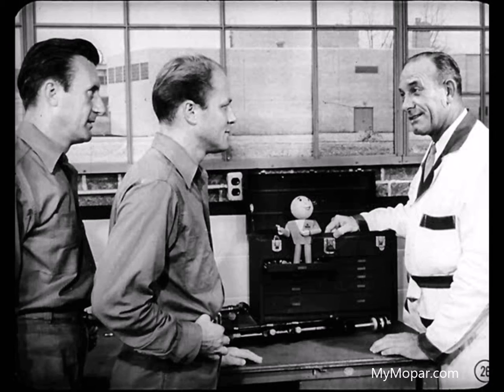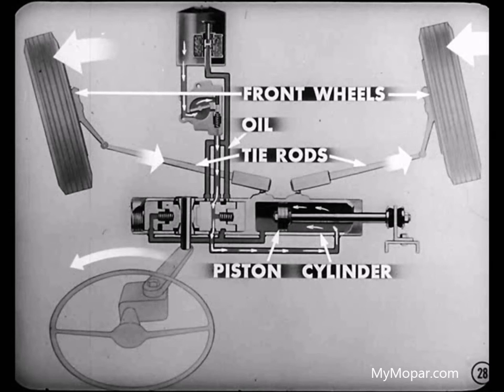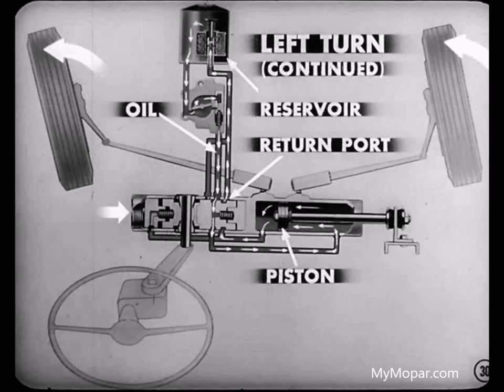Let's suppose that the driver turns the steering wheel. Here's what happens. When the steering wheel is turned, the steering arm stud slides sideways in the valve assembly. This causes the spool valve to move away from the center or neutral position. Oil under pressure is admitted to one side of the piston. This pressure moves the cylinder, which in turn moves the tie rods and the front wheels. For a left turn, when the steering wheel is turned to the left, the steering arm stud slides the spool valve to the right. The pressure port for the passage leading to the right side of the piston is open wider, increasing the pressure on the right side of the piston. At the same time, the return passage port leading from the left side of the piston opens further, permitting oil on that side of the piston to return to the reservoir. This difference in pressure on the piston causes the cylinder to move to the right, turning the wheels to the left.